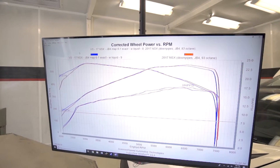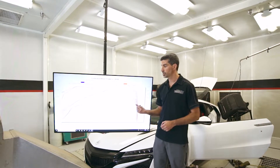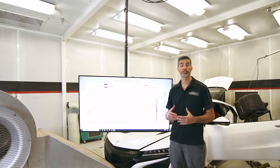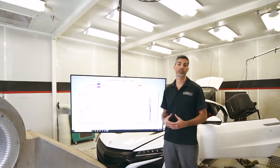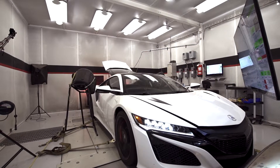It's not just ultimate performance that we're concerned about — it's also repeatability. We were really surprised in some of our earlier testing with the NSX to see how quickly the performance drops off from the engine as things start to heat up. We were finding that after six to eight pulls the performance was being reduced between 30 and 40 horsepower.